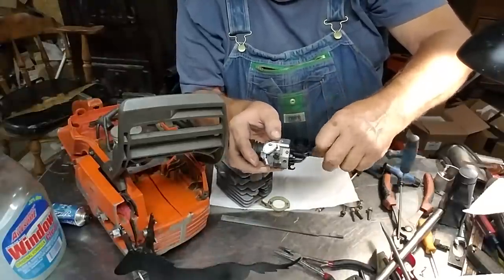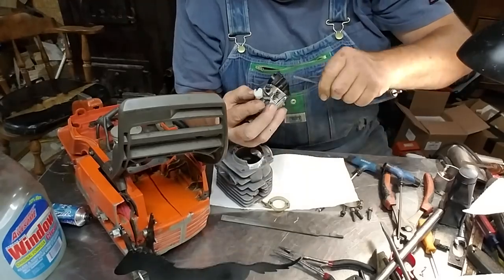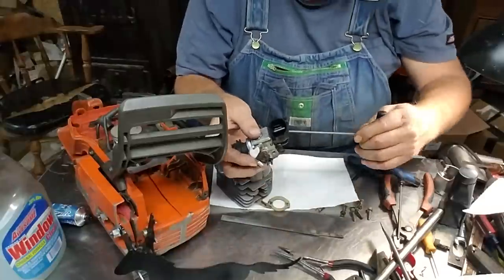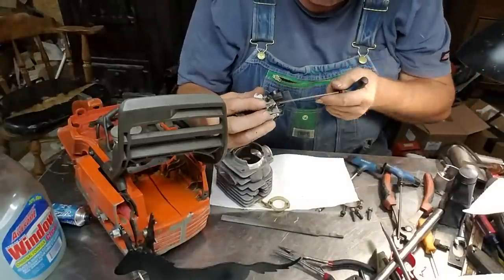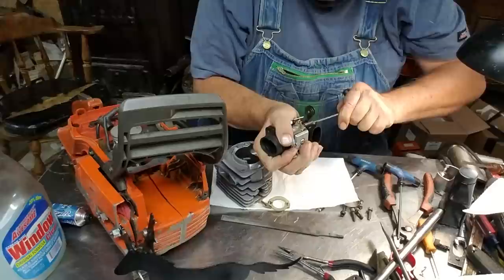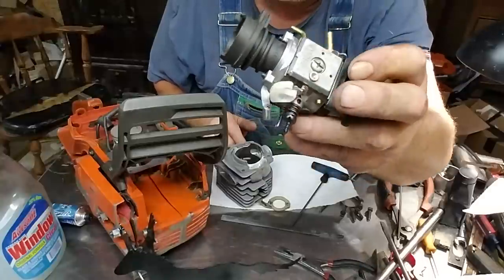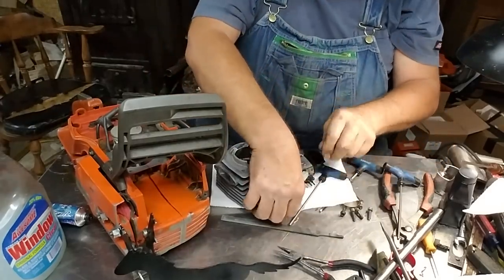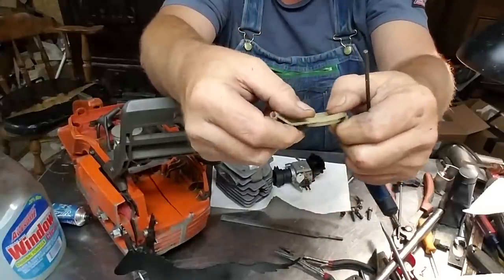You get your air horn mounted. I try to tighten everything easy. Get it even. Now remember, all you're trying to do is seal that rubber. You're not trying to twist its guts out. And there we go. It comes metal to metal. Like with the plastic ones, if you over-tighten that, you bow that up right there in the center, because it bends like that.